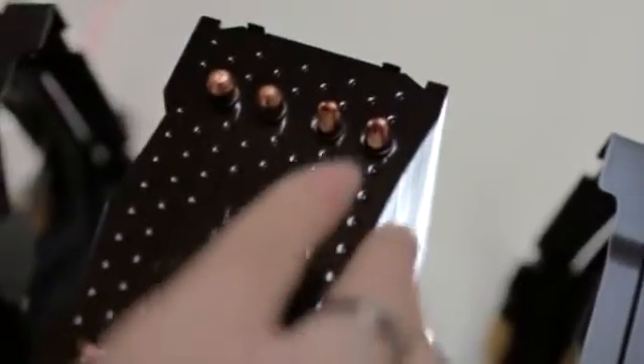Here's the tricky part: which fans to place where? If you didn't know any better — and the instructions really don't say — you'd just plop them on and pray for the best. But there actually is a specific spot for these fans. Notice there are arrows indicating airflow direction. On one fan the arrows flow in, and on the other they flow out. We want the curved side creating an air pocket so air can flow in, and on the pointed-out side, air flows out toward the vent. For a simpler rule: the side with the Corsair logo is where air is going to flow from.